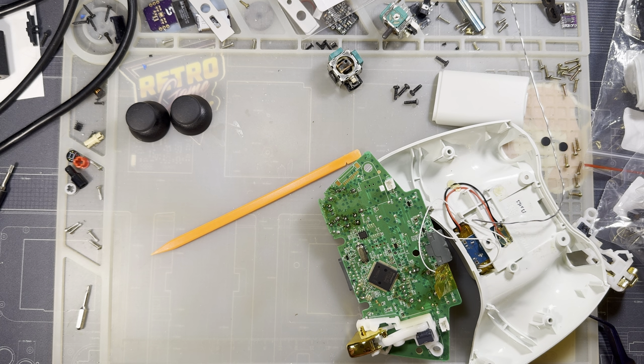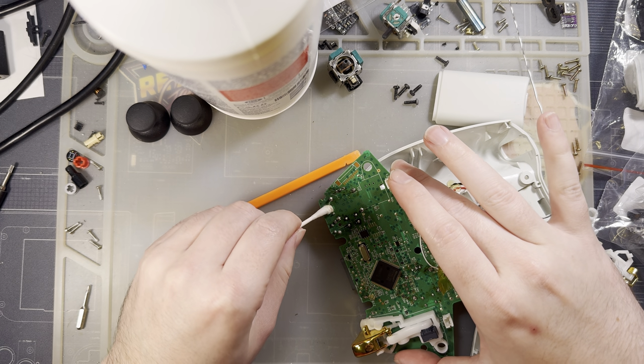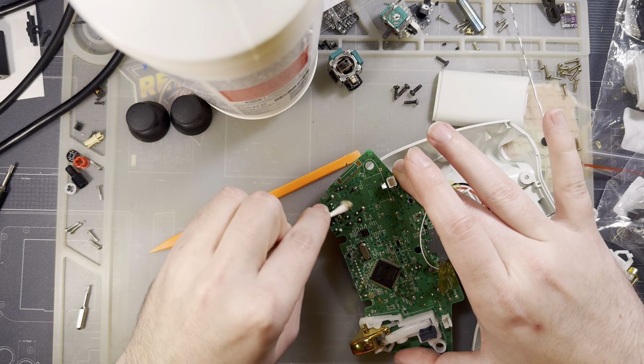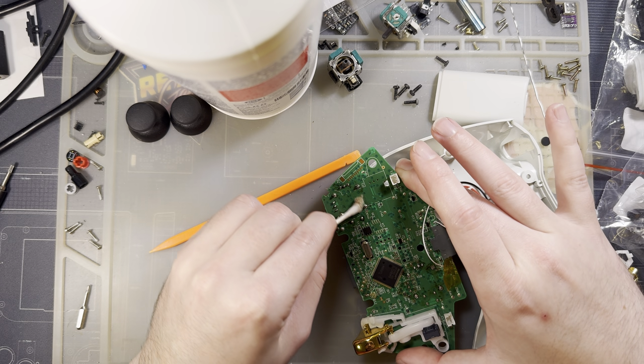It goes by voltage, not resistance, but we'll pretend it's resistance just for the sake of simplicity. Let's say it is a 10K stick. About halfway through the stick should be 5K. Let's say it's not perfect. None of them are. Halfway through the stick, actual center, when this thing is installed in the console, is like 5,050 or something. You just set that value in the firmware, and then the controller's happy indefinitely until some chucklefuck comes along and rips that hardware out.